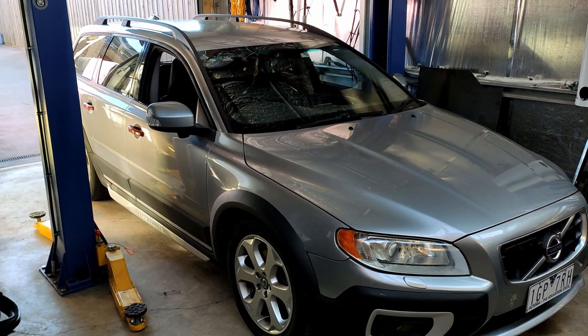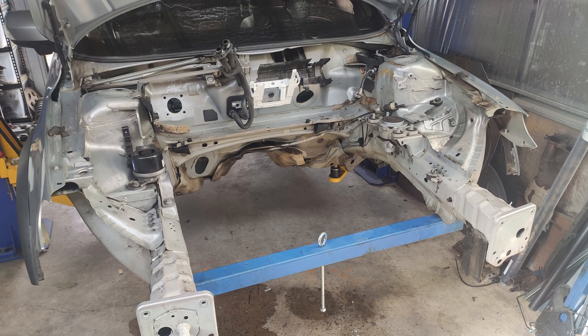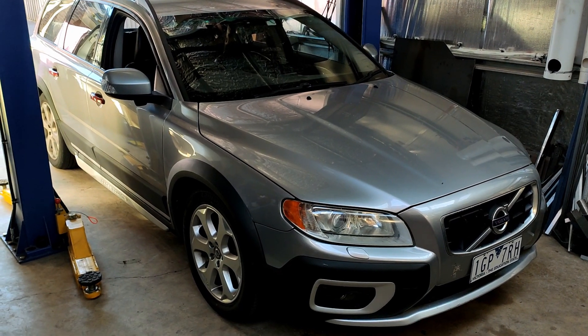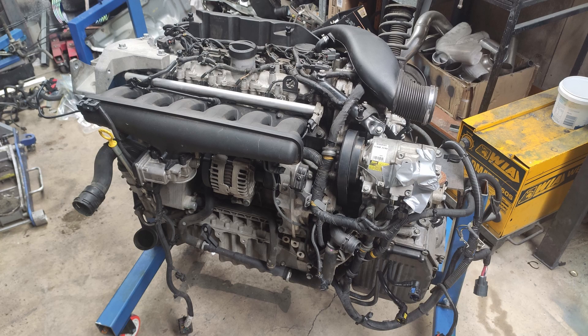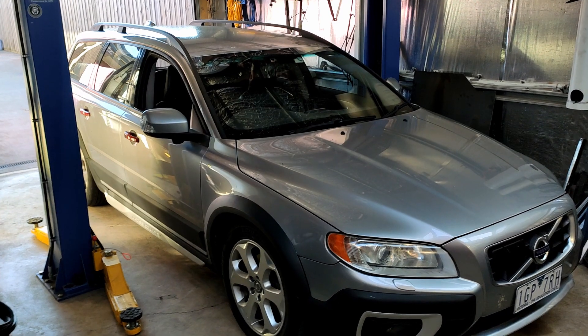That means a full diesel removal, add everything for the petrol — the engine, electrical, and everything that follows on, and there is quite a lot to follow it on. The donor car that I used was a V70 T6, which are pretty common in Australia. I think they had a few options of engine in Australia for the V70 — T6 was one of them. I believe they came in a 3.2 litre and also the D5. Whereas the XC70 in this year, we did not get in the T6 — we only got D5, which is very common, and you'll see the occasional 3.2 litre. The XC70 P3 design did get the T6 in later years — I think around 2014 in Australia. While it is the common engine in international markets, so I've built what everyone else takes for granted as an XC70, but unique here and unique for me.